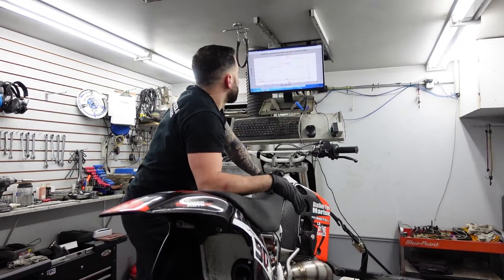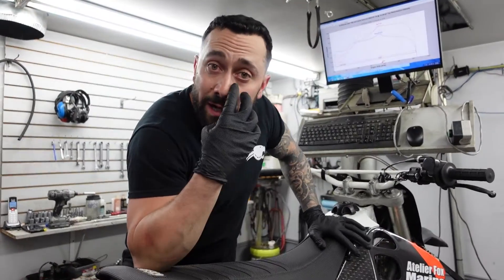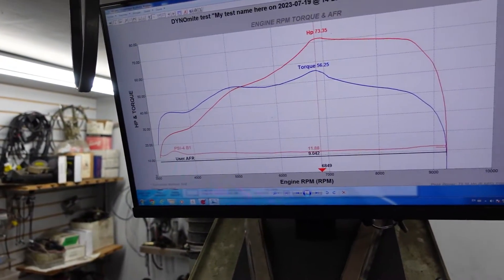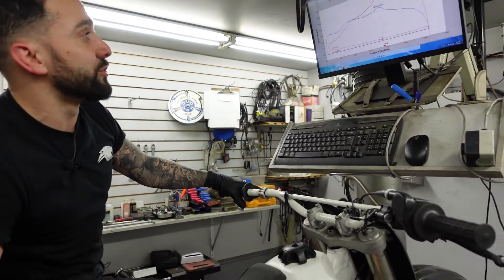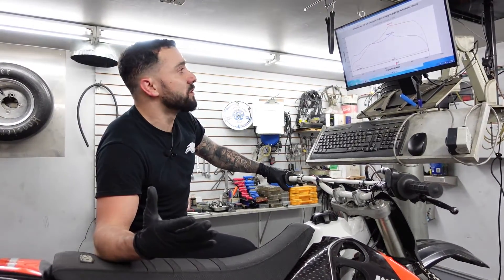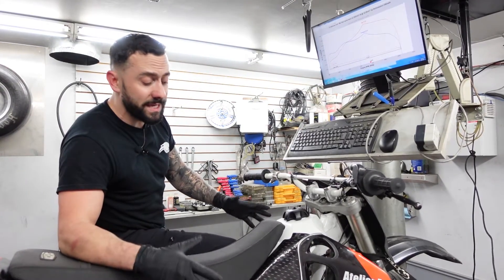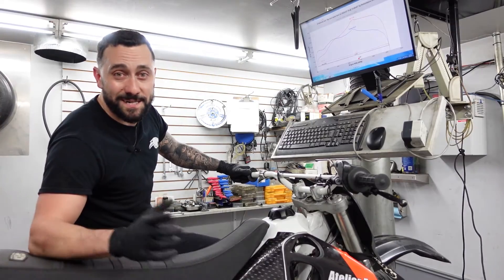Alright guys, we're done for the day. We had some tweaking of the power valve to do — pretty simple when you test a new pipe and new power valve: pull around fully open, fully closed, and you set when your valve needs to open. We ended up with a pretty significant 73 horsepower at the wheel. I think the power valve opened a little early so maybe we could have smoothed it up a little bit, but it's a significant result — pretty cool, almost 50 pound-feet of torque everywhere. Keep following us, we'll do a full video with analysis of those data, seeing how it compares and why it's so different on the Pantera cylinder compared to the CR500. Keep in mind this is fully on pump gas at 11:1 compression, so pretty significant results here. Stay tuned and we'll see you guys for the next video.